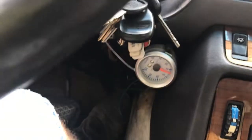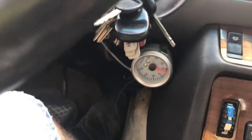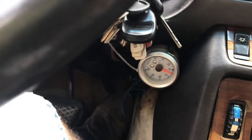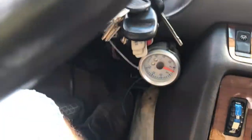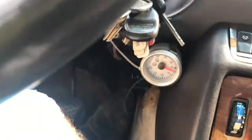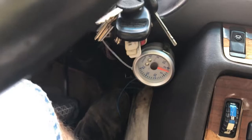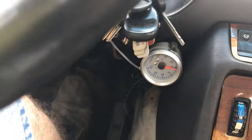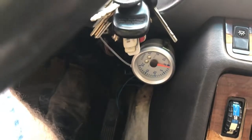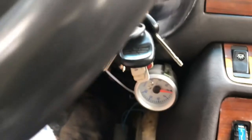We're going to adjust the wastegate. I'll look up at what pressure that valve releases — I think it's 13, 15, or maybe 17 PSI, somewhere in there. That'll tell me where I need to set my boost. We've got it shifting good and the engine's up to temperature, so we should see a lot more boost than 7 — definitely should see over 10. Let me look up the specs and we'll see if we can adjust and get a few more pounds of boost out of it.